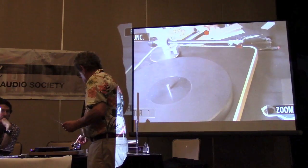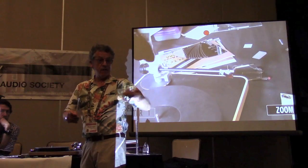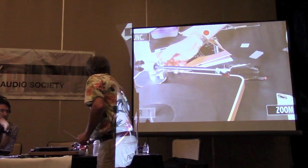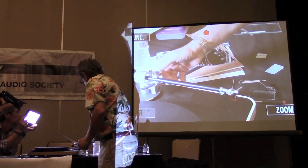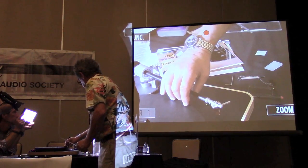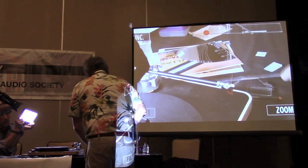That's applied on tone arms either with a weight on a string, which you've seen, and that pulls the arm back towards the outer groove, or in this case, there's a magnet right here. And the more we turn this in, the more of the magnet affects the arm and pushes it away further. So there are different ways of doing this.